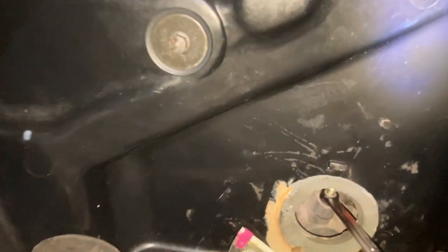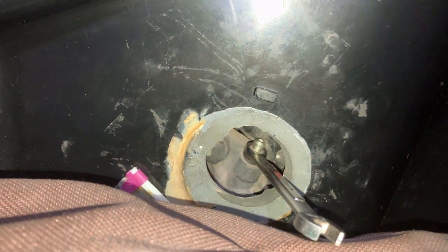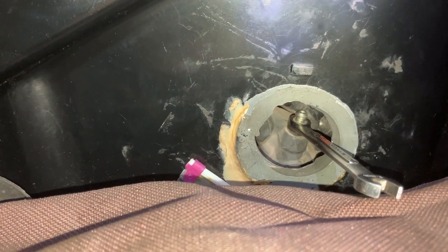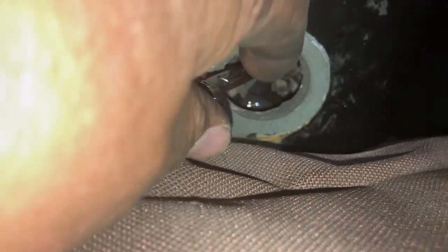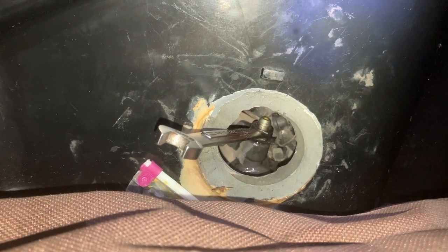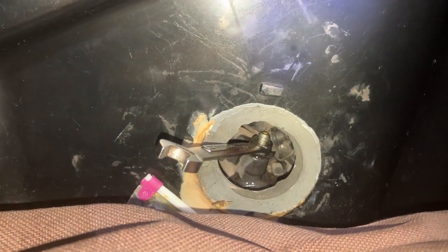This is the saddle bag here. If you go in here, you'll see where the bleeder is — there's a little cover and there's the bleeder for the back brakes. I'm just going to bleed the brakes first to see if the master cylinder has any leaks before we change the pads. As you can see, we've got some fluid coming out of there. Since I don't have any help to bleed these, I'm going to have to get a hose and do some old-fashioned brake bleeding — put a hose on it and run it into some fluid so I can open it, go pump it, then come back and shut off the valve.